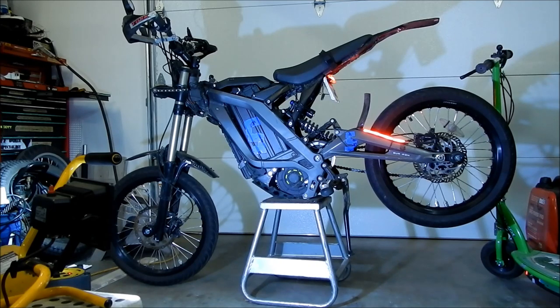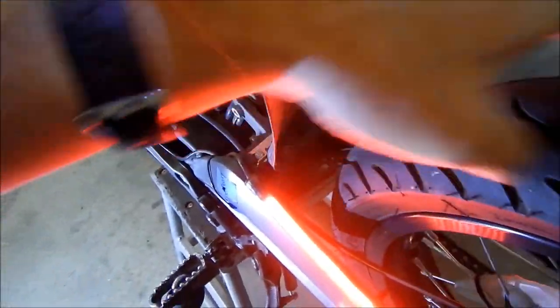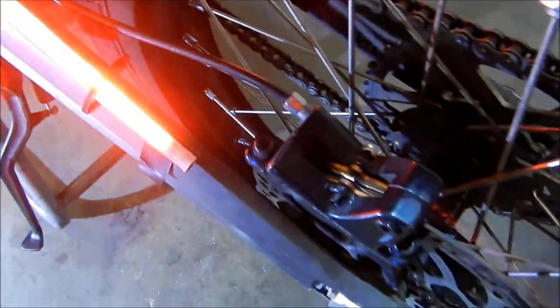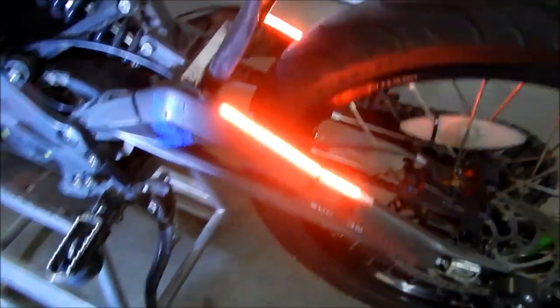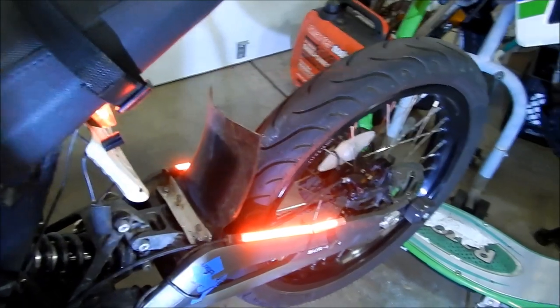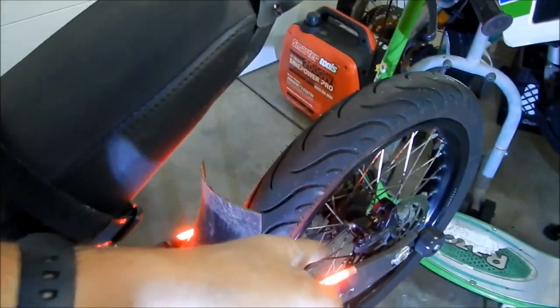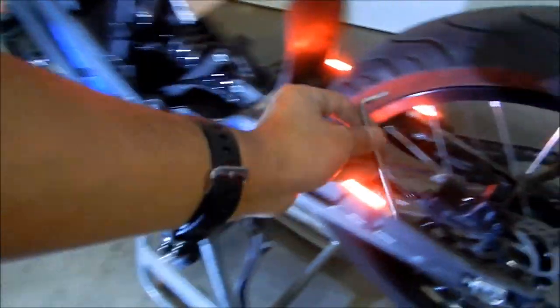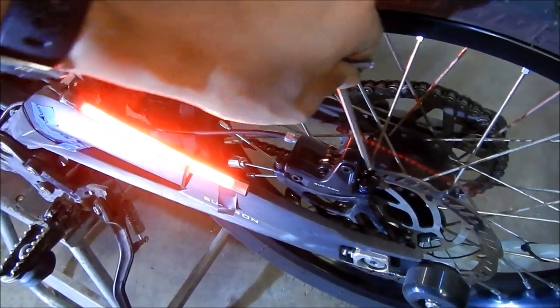After you get it installed, make sure your lever is adjusted properly. If it feels like it's dragging, try to realign it — take your 5mm wrench, loosen the screws, squeeze the brake lever, and tighten the screws again while braking so it lines itself up. Somewhere along the line, take the pads out and inspect them to see how they're wearing. If it's getting worn more on one side than the other, maybe flip them around.